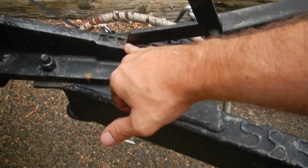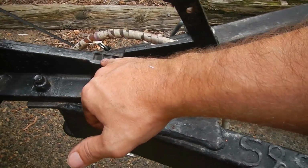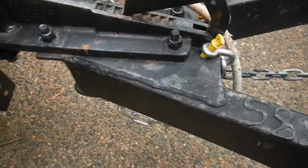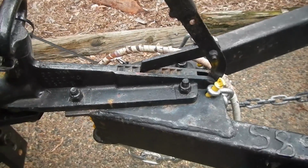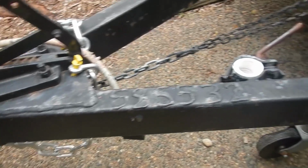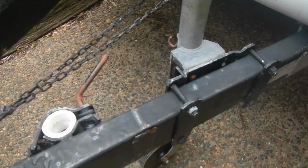And I wanted to give it an equal amount of tension just then. We've only gone 3 points back, and there is a lot of tension on those. So hopefully that's improved our handbrake situation. We'll know that later on. It's not something I want to test right now down my driveway, pointing at the neighbour's house.